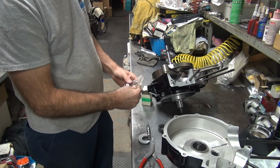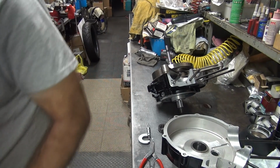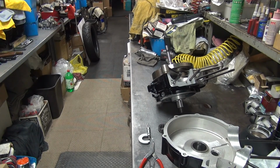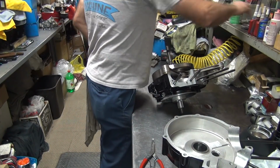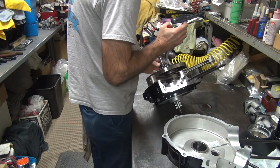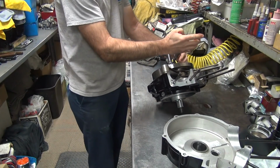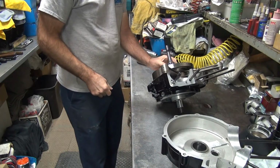that's actually a tenth or so under. So we need like a 4/10. You got a 4/10? That made it simple. We're honing it. So we have to hone it because we have no bearings. The ones I got I think are bigger than these ones. See, that was quicker than yesterday's practice.